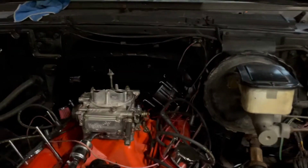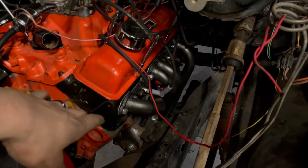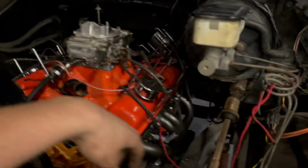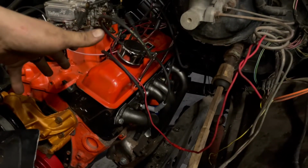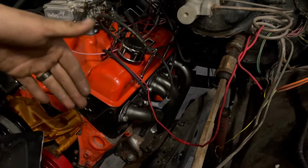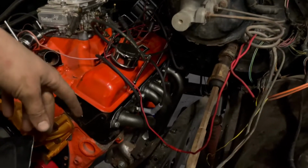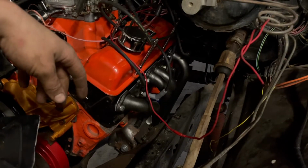All right, well, I did a little digging in it, figured out what's wrong. With cylinder one at TDC, top dead center on the compression stroke, we're 180 off. That would explain some stuff. I don't know why it didn't make even any fire sound, like it was even trying. But I guess we'll put it all back together this way, get that fixed up there on the distributor, and try it again, I guess. It's about all we can do, really.